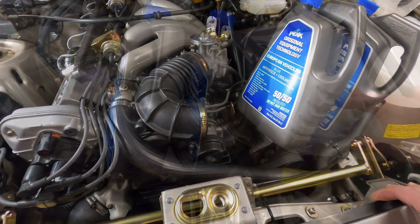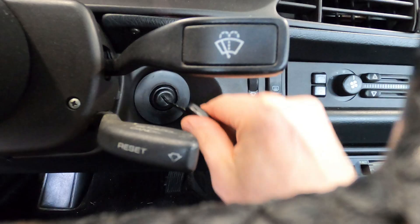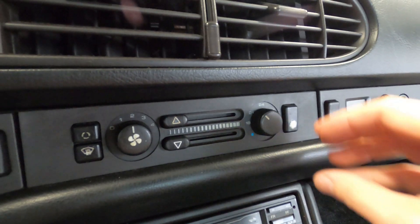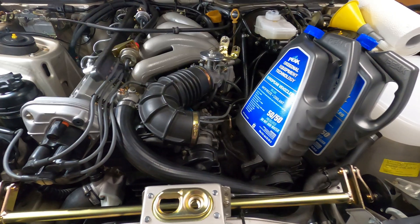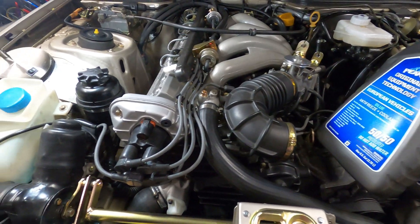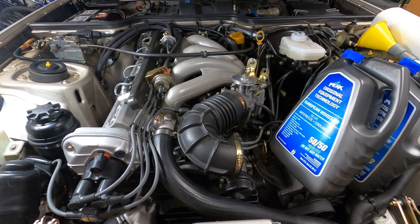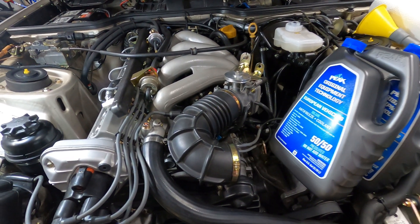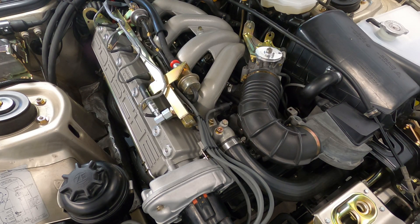If you're using the gravity fill method, we'll need to vent for some additional cycles. Go ahead and start the car. Make sure that the HVAC system is set to full heat and we'll need to run the car until it reaches operating temperature. The two gates in the system are the heater control valve and the thermostat in the water pump, and we need both of those to be open to evacuate all the air from all the different cavities in the system. Once you've run the car to operating temperature, the temperature gauge on the dash should be just under the halfway mark and the electric fans will kick on. At that point, you'll know that the thermostat is open and fluid is moving throughout the entire system, and we can begin the venting process.